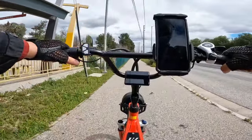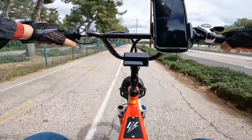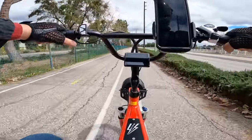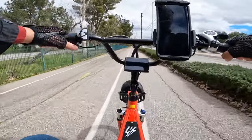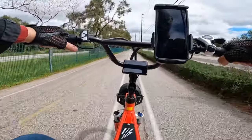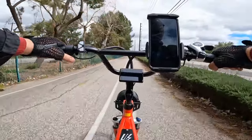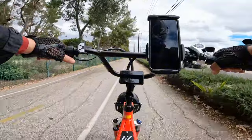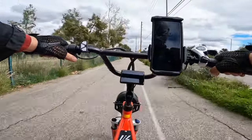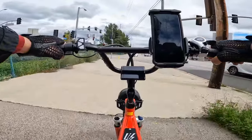Since this is going to be a stop-and-go, we're probably going to discharge the battery. I hope I'll ride at least 14 miles based on my previous experiment — about one mile per amp, and it comes with a 14 amp battery. I'm heavy and the motor is only 500 watts continuous, not peak — it can go up to 850. Right now it's drawing 7.3 amps and the speed is now 26 miles per hour. It brings up the speed eventually, though it's not super fast like some people expect. I think it's a very good speed for this type of motor — 500 watts slim hub motors are usually not as powerful, but they should be efficient.